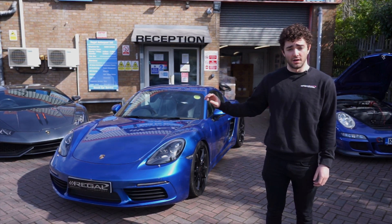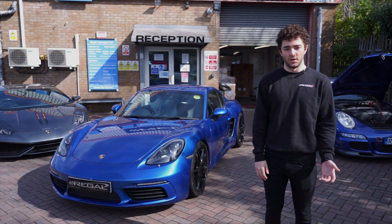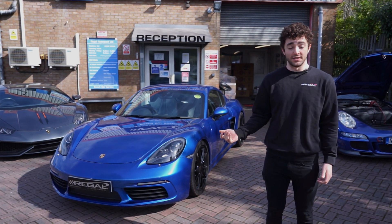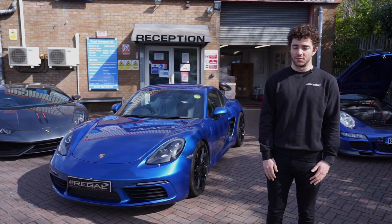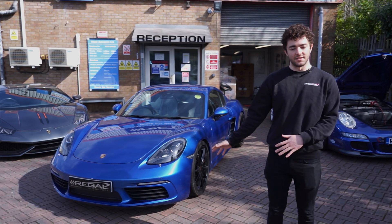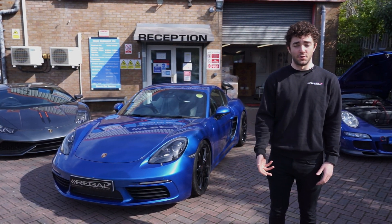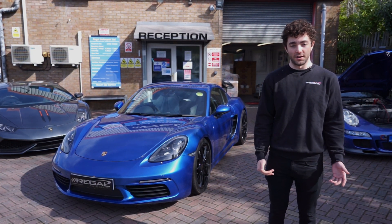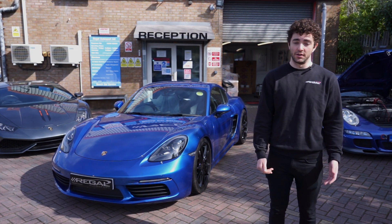With the third center radiator — these Caymans only come with two side radiators, one either side — we're going to be installing a third radiator along with a bunch of original Porsche components. The customer is driving the car on track and even on the motorway the car sits around 100–110 degrees water temp. That isn't necessarily a problem on modern cars, but if you're pushing it on track and want good reliability long-term, you want to keep coolant and oil temperatures managed.